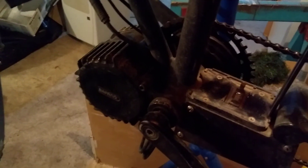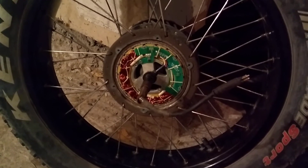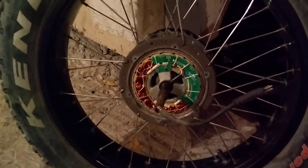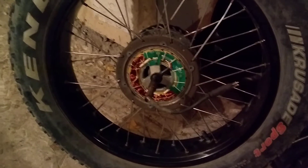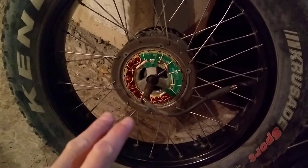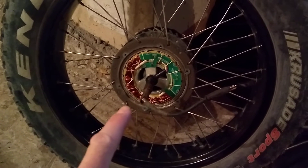From experience, I just want to show you what happened to my hub. I was using the original hub motor — just as a regular hub with my freewheel on it. This is a 500-watt nominal, 850-watt peak output hub motor from 8Fun, which is essentially Bafang under a different label. I put over 4,000 kilometers on this motor, then disengaged it and used it as a hub once I got my BBSHD — and I've put that much mileage on the BBSHD using this as the hub under all that torque.